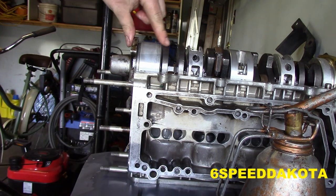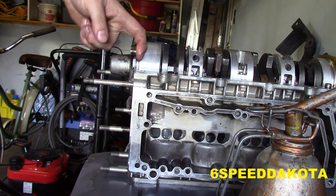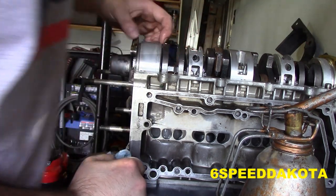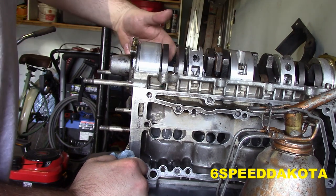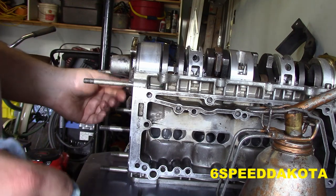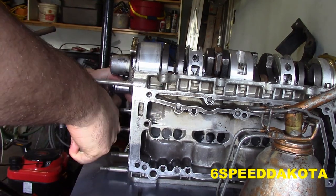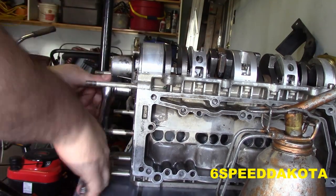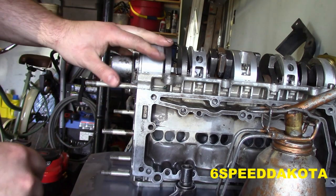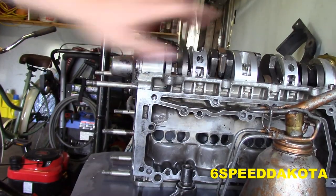Now, if you have too little end play and you don't feel like adding shims, one thing you can try is double check that your bearings are actually sitting flush. If your bearing sits up, it's going to impede it. I just tightened this up with a ratchet. We didn't do anything exotic with this. So now it's time to continue the assembly of the motor, which means we're going to put the seals in. We're going to unbolt and remove the bearing blocks, and move on to the next step, which is putting the casing back on.